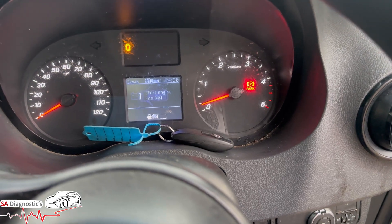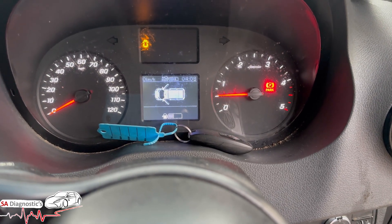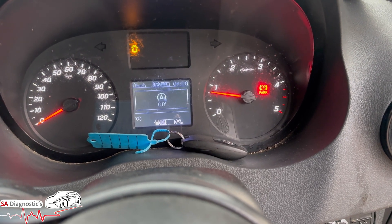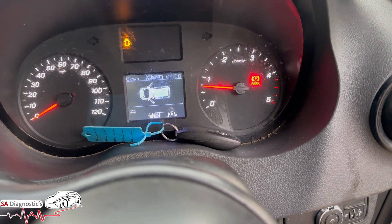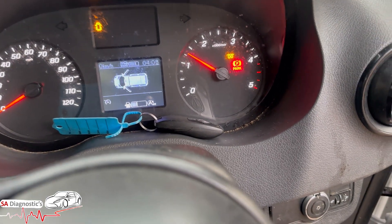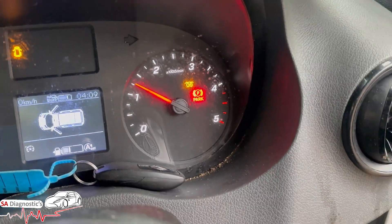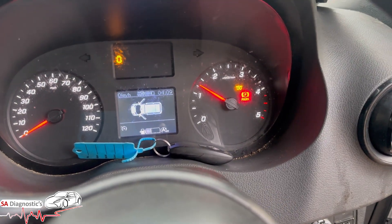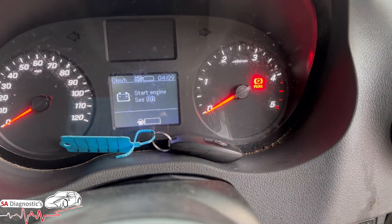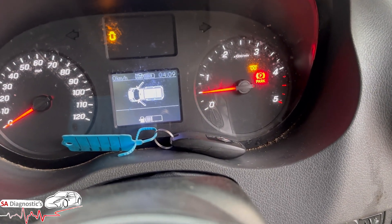It should hopefully start — it will take this long sometimes, sometimes less. You can do a manual bleed as well. There it goes — it's on. It'll take a while; it is a cold start and you've just had the injectors off. I'd do a good run afterwards. The coil light coming up is the glow plug — but everything is good.